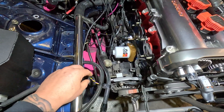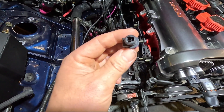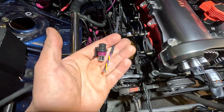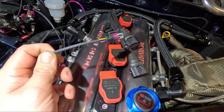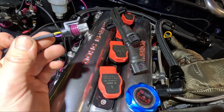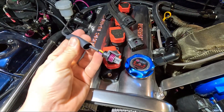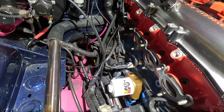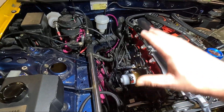The ECU Masters 10 bar sensor comes with a plug, and that plug is numbered: number one is sensor ground, number two is 5 volt, and number three is sensor signal. That was a little fiddly, but it's all in and locked in place — the plug is really high quality and high tolerance. I'm going to slide some DR-25 over the plug to finish that off. I've then routed that wire with the rest of the wiring harness and plugged that sensor in.